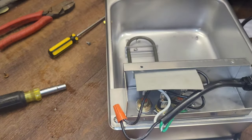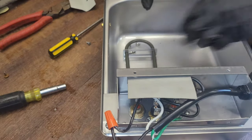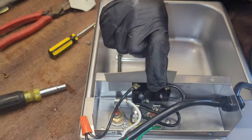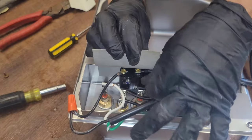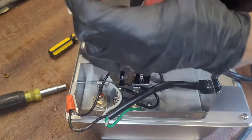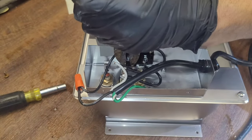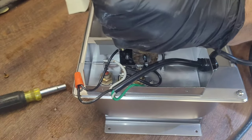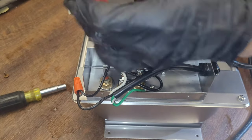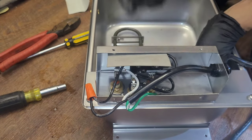Started it with my fingers, and the other one too. Now they're both starting — grab it with the backup and tighten her down. And just to be sure, you've got to make sure that the float that's in the pan rises and energizes that switch — like that. You've got the float right here; when water hits it, it's going to go up and trigger the switch.